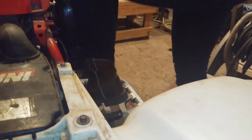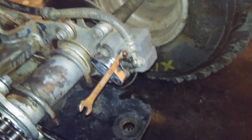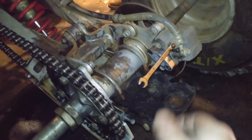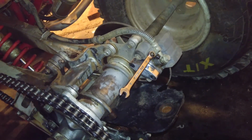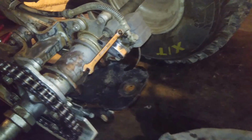Oh yeah, it's definitely gone down a little bit. Hold it down. Pump it up. Hold it down. Pump it up. The fluid's starting to come through. It's like red, nasty. It's starting to come through clear now. Let me know when you're ready. Okay, hold it. And pump it. Okay, and hold it. And pump it. Hold it down.